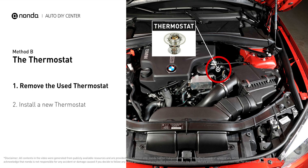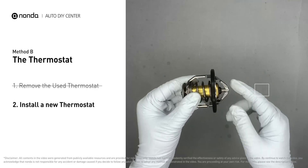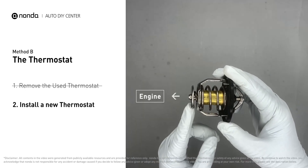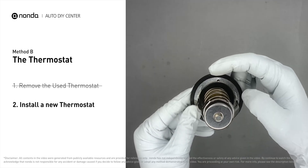The engine has to be cooled before attempting the process. Then install a new thermostat. To install it correctly, you need to make sure the short end goes toward the hose and the deep end goes towards the engine. When you install it back to the engine, make sure the jiggle valve is pointed straight up to the top of the engine, so the air can get through the system.